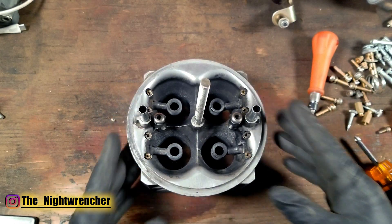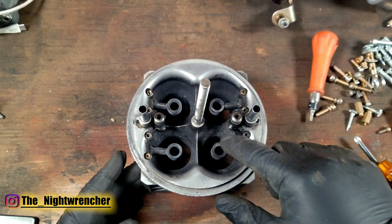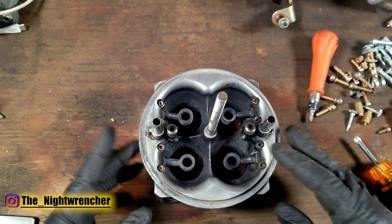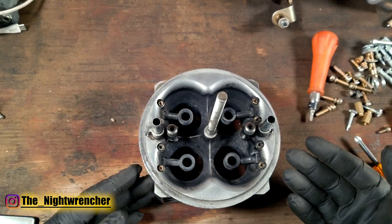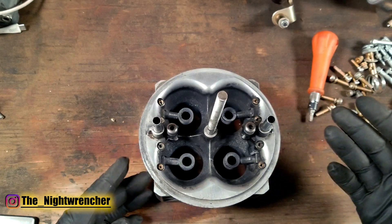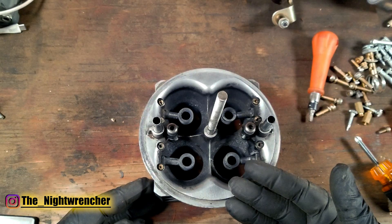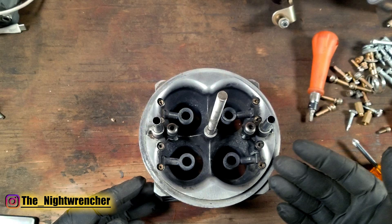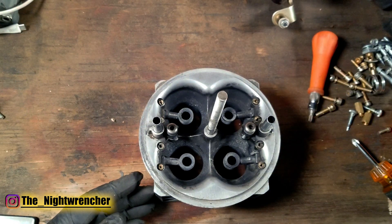On the main body itself, when you buy the dedicated E85 carburetor, the boosters are going to be a little different — the orifices are slightly larger and the design differs slightly from gasoline counterparts, but it should work fine as-is. The air bleeds are set up about five sizes smaller on E85 carburetors. If your carburetor came with a 70, you might have to drop down to a 65; if it came with a 30 or 35 on the high speed, drop it to 30 or 25. But I wouldn't touch those until you get into the nitty-gritty of the tune.